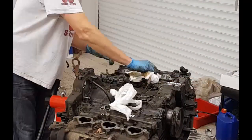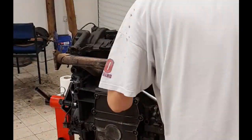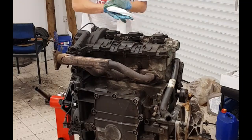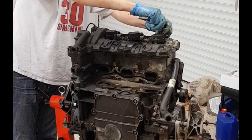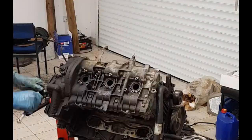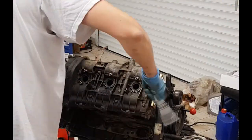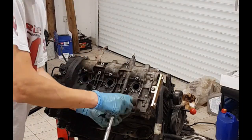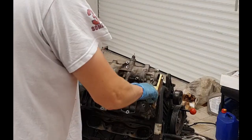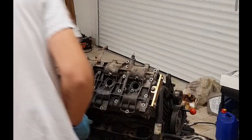This is the vacuum parts — the vacuum tank as you can see on the left. Now removing the exhaust manifolds. Fortunately on this car the exhaust manifolds came off easily. I unbolted the bottom manifold as well, then starting on this head — removing the coils, tilting over to give you a slightly better view, then unbolting the set holding down the camshafts so I can remove the cover. I'm undoing all the bolts on the cover and just tapping it to get it off.